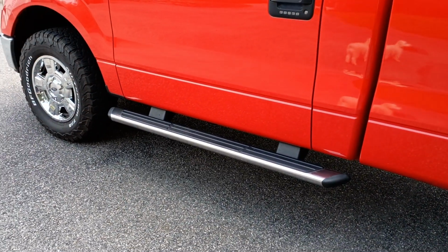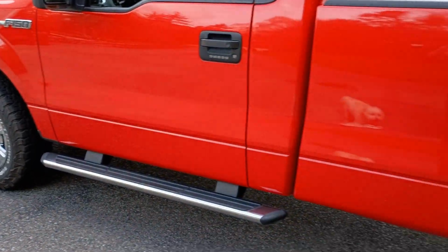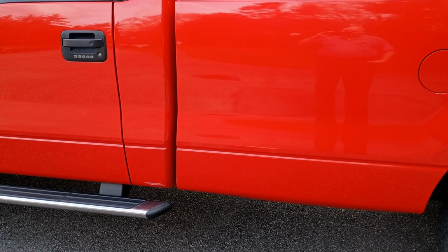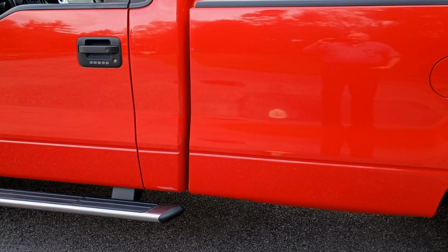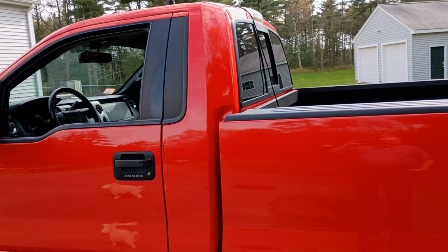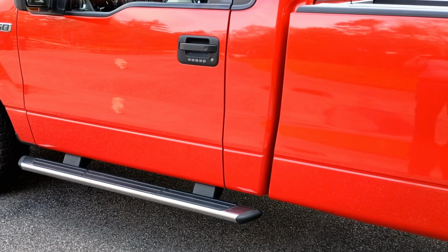And then I put a whole bunch of grounds. So I have about 10 of those silver straps all the way down. Plus, like I say, tied to the cab to the bed. And now everything is tied in. So if the radio signal is looking for metal to reflect off of, this thing has all the metal it can get. And it seems to work very well.